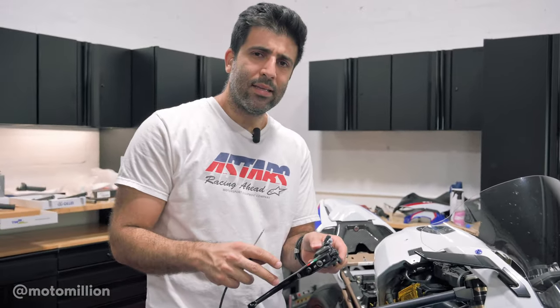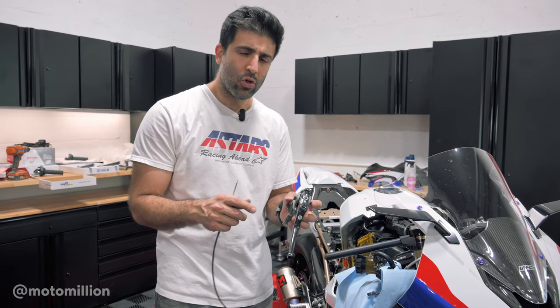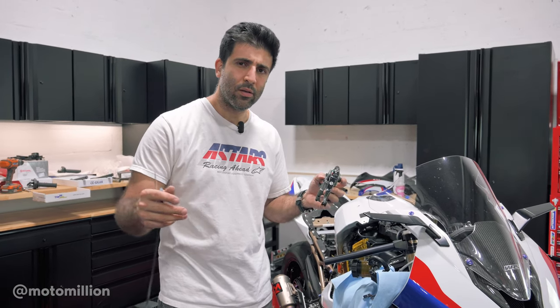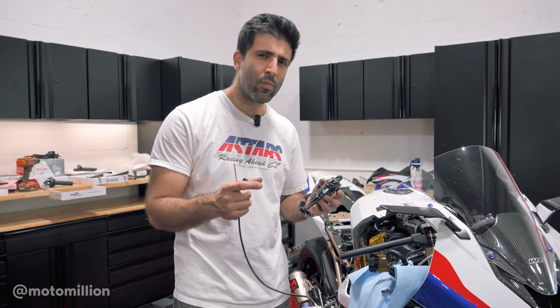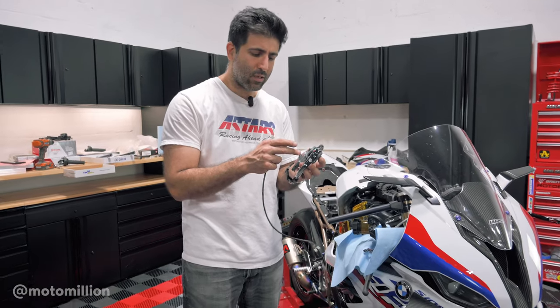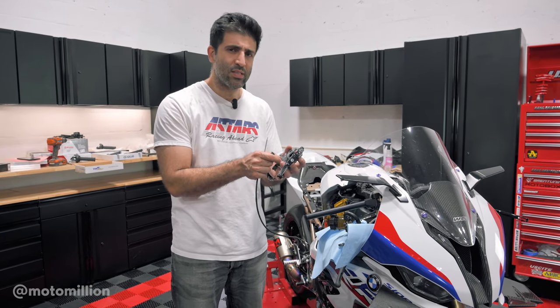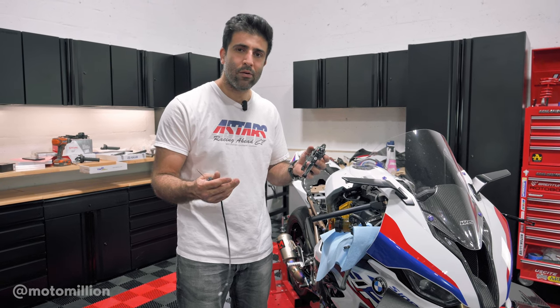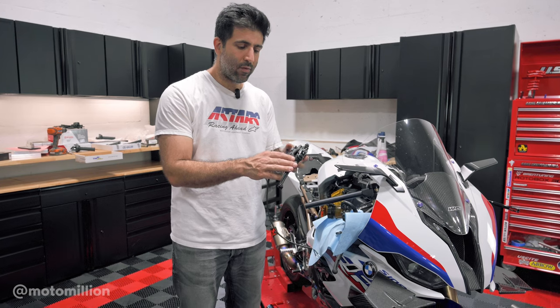You're wondering why 19 and not 17 or 16 or 15. The 19 is the piston size inside of this master cylinder and usually you match it to the piston size of your calipers. Brembo gives recommendations on what to run on what calipers — Brembo calls for the 19 RCS Corsa Corta to be used on the GP4RXs because they have 34 millimeter pistons. You could run a 17, that's kind of undersizing it because the piston is smaller. If you have enough experience and want your brakes to feel a certain way you can play around with that, but for most average riders Brembo's recommended spec is the 19 RCS.